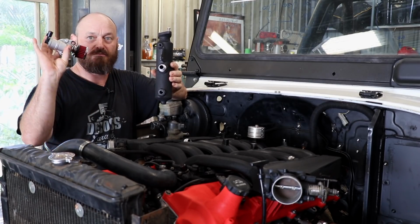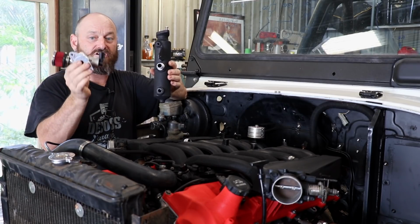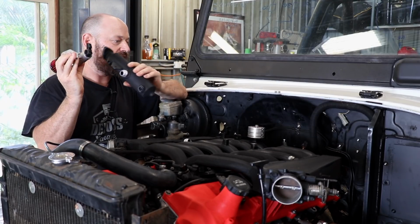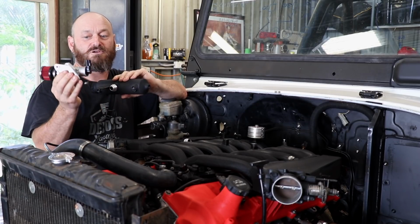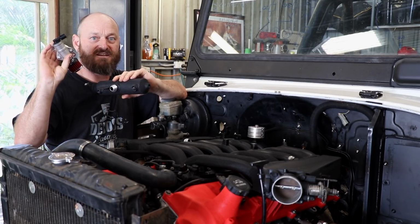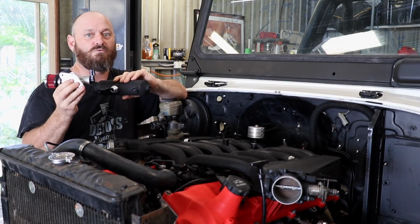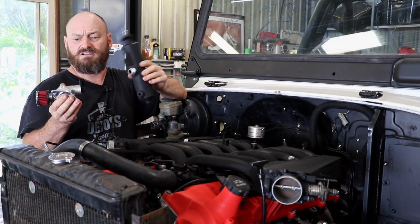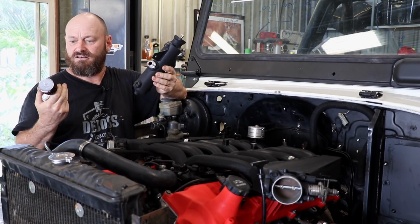We got this from our mates at Golby's. They carry these in stock. They're very cheap for what they are. Really good design. Works on obviously any 1 or 2JZ, and we also adapted one of these onto our 1UZ in the Fairlane, which worked out really well. Same reason, we didn't want to go to the trouble of using all our outputs for a stepper motor. So we'll bolt all this together, whack it back on the engine, plumb her up, and continue on.